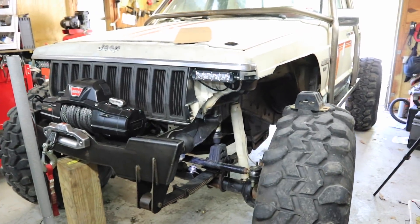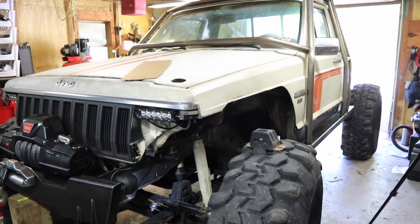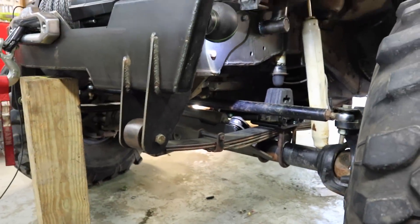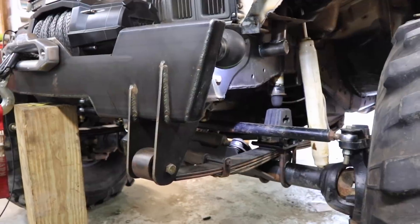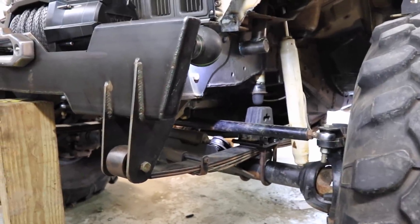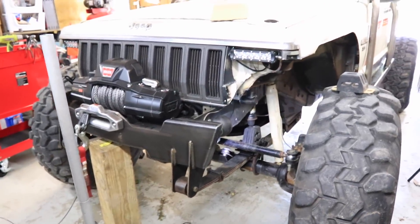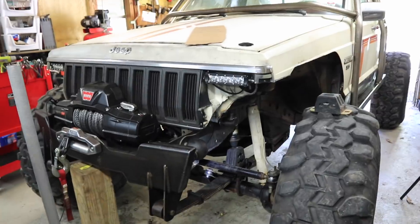I know a lot of you are probably wondering why I didn't just do a 4-link or 3-link in front. The point of this project was to take that CJ and use everything off of it and just swap it over to the Comanche. Looking back, I thought that was going to be really easy, but setting up leaf springs without any predetermined mounting points turned out to be a huge nightmare. If I had to do it over again I would probably do a 3-link. But I didn't have to pay anything really because I already had all this hardware — it saved me maybe 2, 3, 4 grand. The point was to turn all the pieces off that CJ into something cool on this MJ.